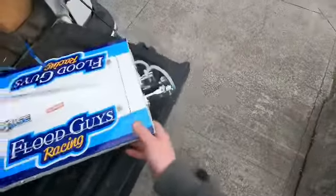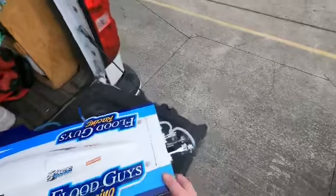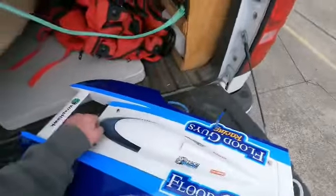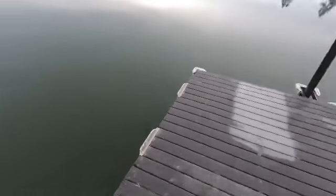Now, as you can see, I have changed the rudder on this one too. The rudder from the Pro Boat Impulse 32 fits just perfectly. And the water pickups are big and open like that, on both sides. We'll see how everything runs. Got the temperature gun, boat is on, it's working, and we'll see what it does. Now this is set up for 4S running, and for the hull and how it does, it's quite fast for what it is.